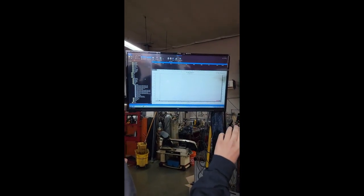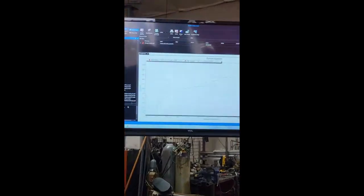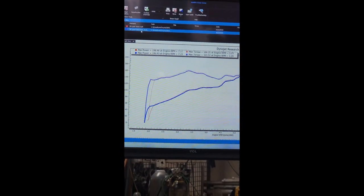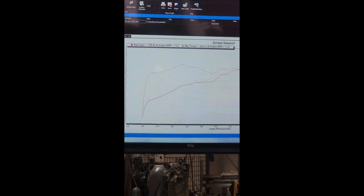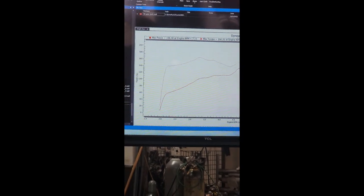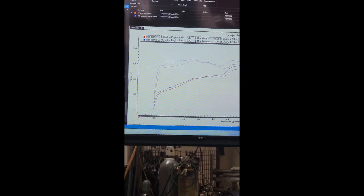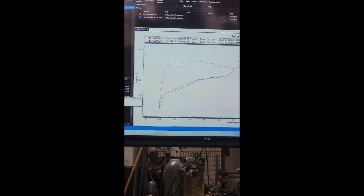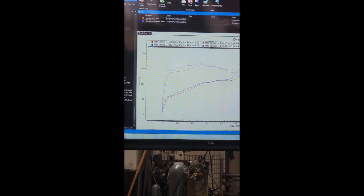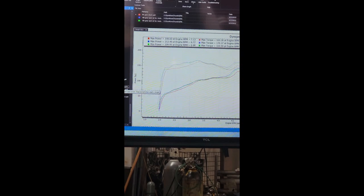Okay, so we're at 212? Well, let's figure it out. Fourth gear stock was about here. I think 198 was our best fourth gear stock. Track mode, we lost a little bit of power, so we won't use that one. And then we had our fourth gear open air box mesh cut pull 3, I think ended up being the 212. And most of the exhaust drop stuff was kind of horrible. Open air box, that was fifth gear. Open air box, but yeah, most of the exhaust drop stuff was fairly disappointing.